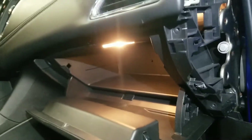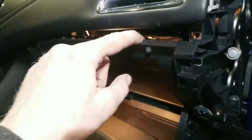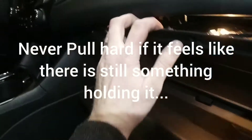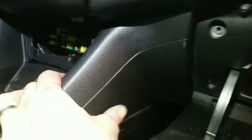There shouldn't be anything else — it should be only clips. Once you remove those four seven millimeter bolts, you gotta gently pull it evenly. Don't try to pull it by the door; pull it from this side first. I forgot — this piece gotta come out first as well. This piece comes out, here's your fuse box, and then this little corner piece gotta come out too.